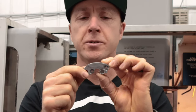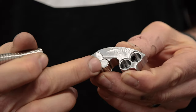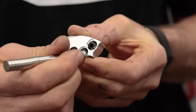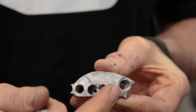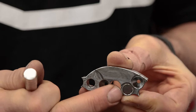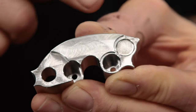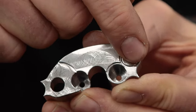Let's go over what these different things do. We can add four magnets to every hole here. If we add it to the lower hole, that's 5.6 grams we just added down here, and it's going to bring the center mass backwards. We can pull the weight out just as easy as we put it in. We can add the same four magnets or two magnets towards the tip down low. Weight out here is going to act heavier — when it comes over center it's going to be more effective at higher mph, so it's going to have low impact at low speeds and high impact at high speeds. By moving the center mass to the very end, this weight acts way heavier because all the weight is at the tip. Anytime we move the center mass outward, this weight value is worth more.